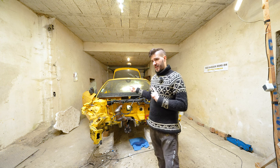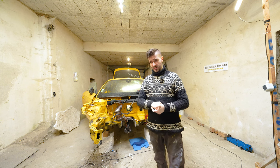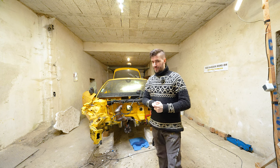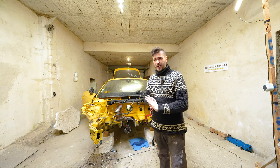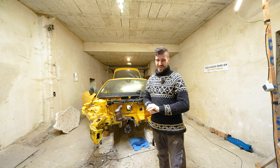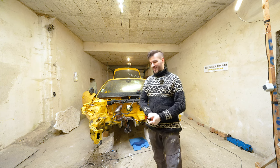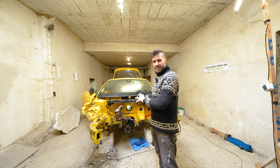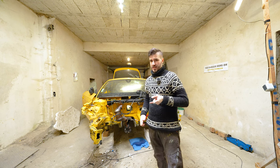The exhaust pipe is connected with a clamp, which has two 13 millimeter screws that are rusty as hell. I managed to get one of them turning and I stripped the other one, so I'm probably going to have to cut them and order a new clamp. Not that I wanted any more of the extra cost. But I think for now, I'm going to leave that and concentrate on starting to remove everything that's damaged from the engine.